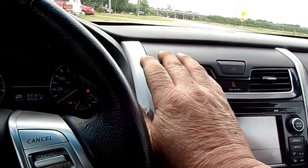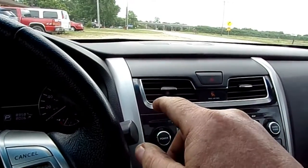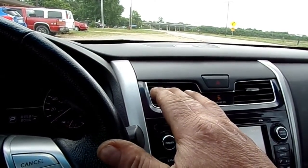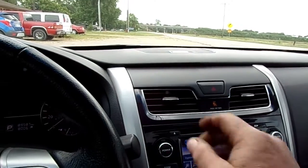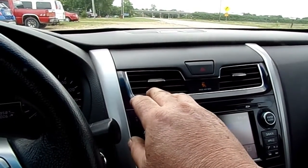Well, that feels good. I don't know if I mentioned it, I put 19 ounces, 20 ounces, something like that. 1.16 pounds, which is, I guess, between 18 and 19 ounces. But your lines will hold a little bit of Freon, so you'll be all right at about 19, 20 ounces.